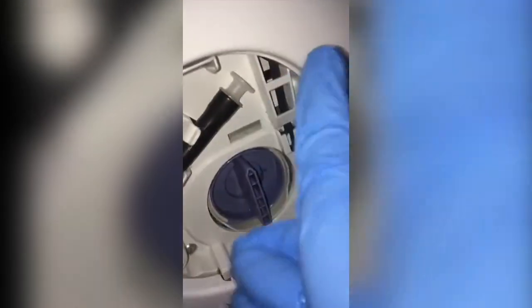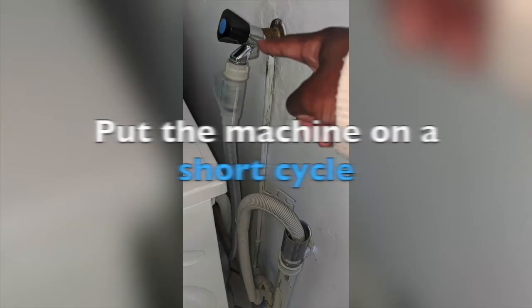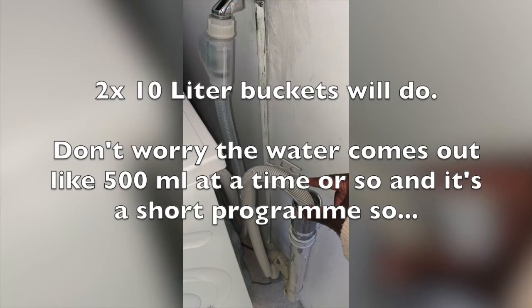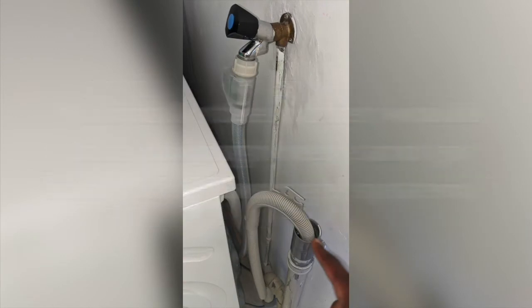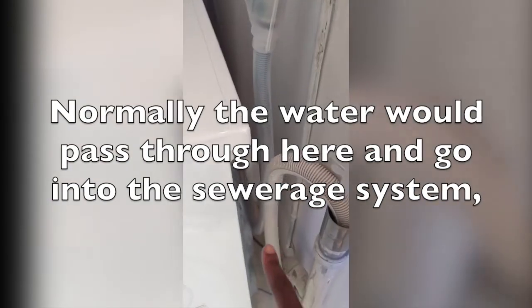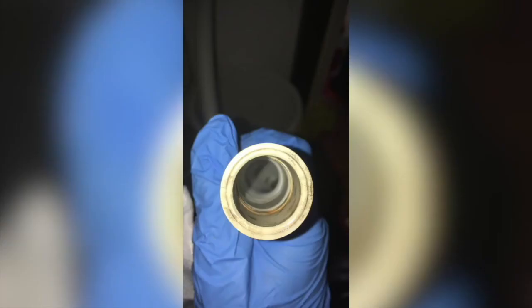Make sure that thing is standing upright vertically — then you know you're good to go. Another thing is this tube: make sure the tap is on and go through a proper wash cycle. Make sure you have about two or three big buckets because you're gonna wash and all the water is going to go into these buckets. This was so gunky and disgusting because all the fabric softener and powder and whatever else gets all clung together and goes through these tubes. As you can see, these tubes are not very big and they've got ridges.